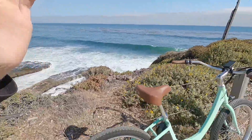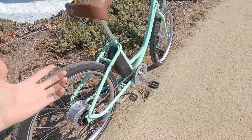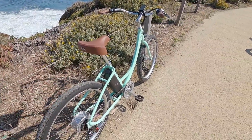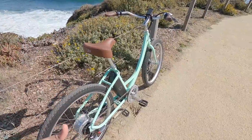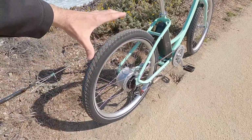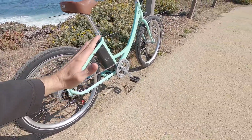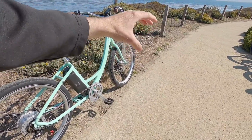And so they've actually upgraded the controller on this bike as well to handle additional amps. I mentioned 48 volt battery before. That's a little bit more efficient. It sends electricity with potential for higher power, and also you're losing less of that energy as you go. With a slightly wider or taller wheel, you get the advantages of a lower attack angle, which is improved comfort. You can kind of roll over things instead of falling down into them.